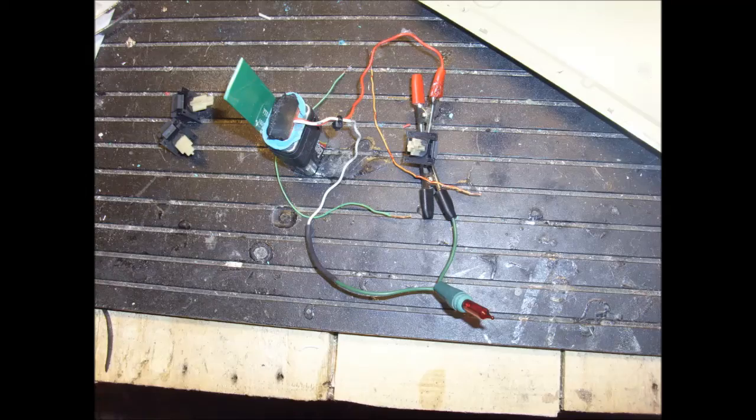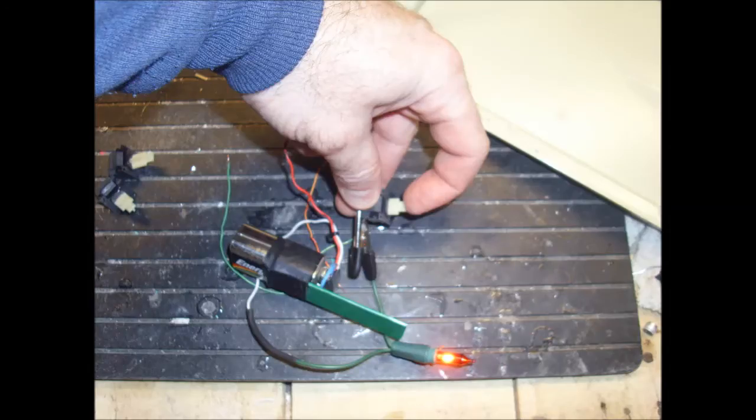One more critical step that you want to remember too is to test the switch before you actually solder it into the recipient keyboard. A lot of them do have problems. For my test, I just have a simple 9-volt with a resistor and an old Christmas light. Complete the circuit when the switch is in there. You can use your fancy stuff, but this is my poor man's continuity tester.